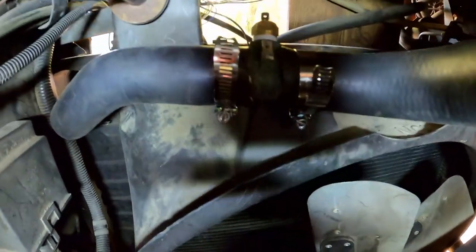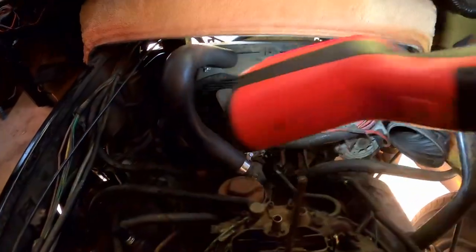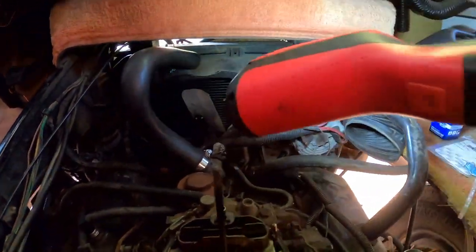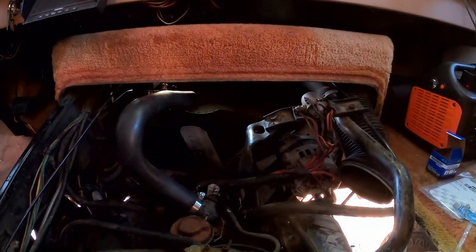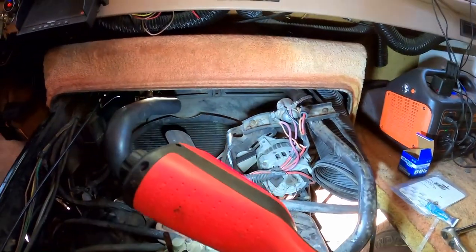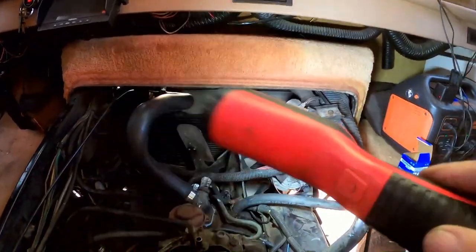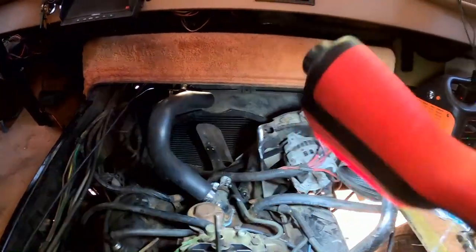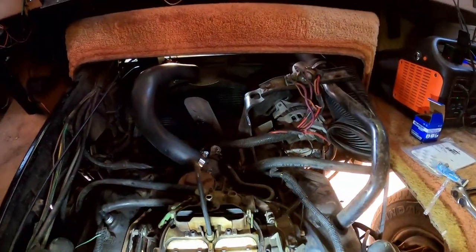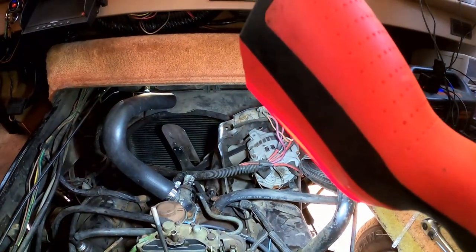I'm gonna go ahead and hook the wires up. Now I'm not gonna worry about that a whole lot right now. But the water system's all back, the hose is all back and everything, and I think it's safe to go ahead and put the antifreeze back in it, because, push come to shove, if we needed to leave for some reason, that's a good stopping point to me, is that it's together. We'll put the coolant back in it, warm it up, check for leaks. Yeah, I mean, I may have missed something stupid, and that way the rig's actually usable again at that point. So we'll just go ahead and do that.